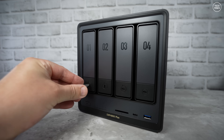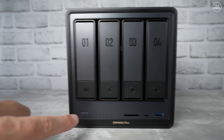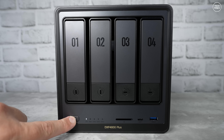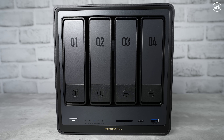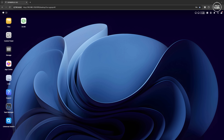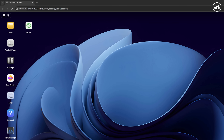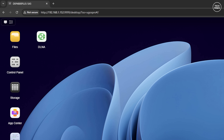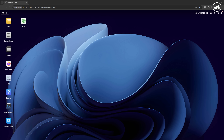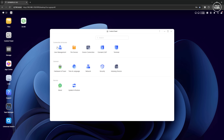Once you have the drives installed, just plug it into your network, attach a power supply, and power it on. This NAS is completely controlled via a web browser. The first thing you'll need to do is go through the configuration where you can set up an admin user and choose whether the drive system will be set up purely as storage or whether you use a RAID system where the same data is stored on more than one drive in case of failures.